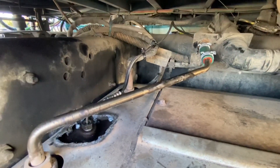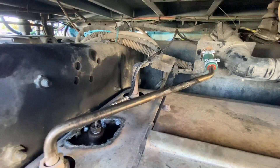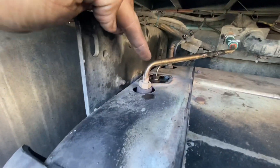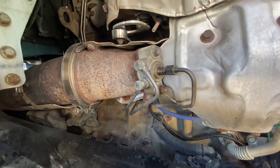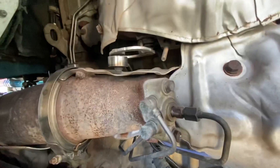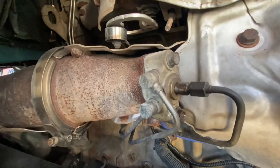We're going to do a regen right now, but when I first did the regen, this sensor was reading at about 1,200 degrees, which is insane. This hose was replaced — it's part of your DPF pressure. This tube feeds up into a pressure sensor. The other thing I did is I went ahead and checked my doser. When I was doing the first regen within 10 minutes, the doser itself was starting to work. So this is the diesel doser — we removed it, cleaned the carbon, and found out it was actually sticking open.